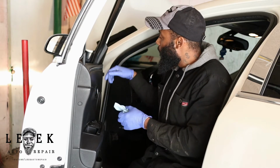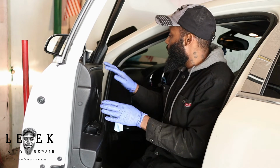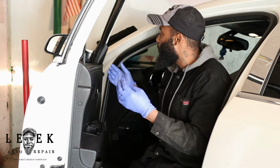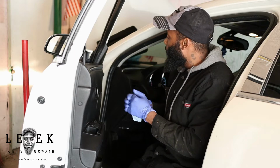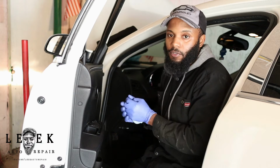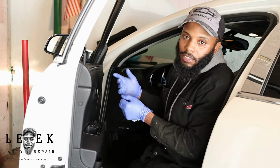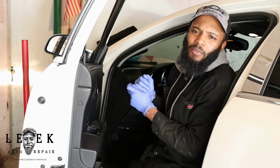So what I'm gonna do is, I've got the left front tire off, and then I'm gonna move the shield back. The shield is already missing some clips. Mind you that you will have to remove some clips. I'll let you know which ones are going to be removed, but this car has been worked on before, and nobody put things back properly, basically. The horn is in the left front wheel section. You gotta move the wheel well shield back, basically the inner shield lining, whatever you want to call it. There's all types of names for it. Move it back, and then it's a pair. It's not just one. You can usually have a high and a low, or maybe two highs. I don't know what they're doing nowadays anymore, if that makes sense.